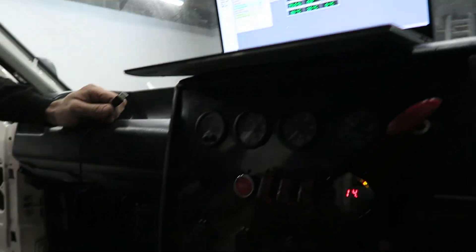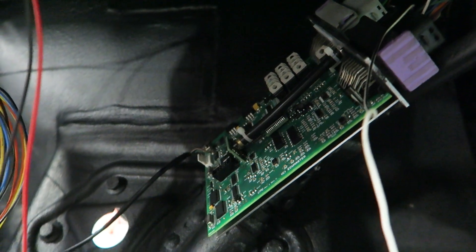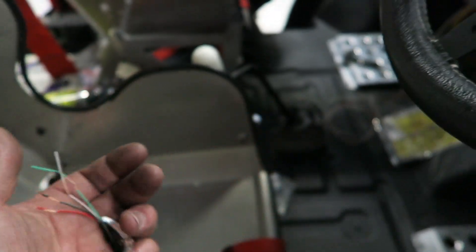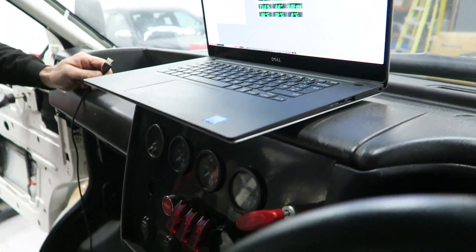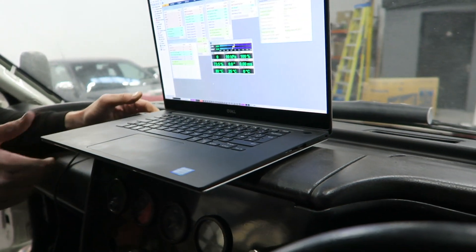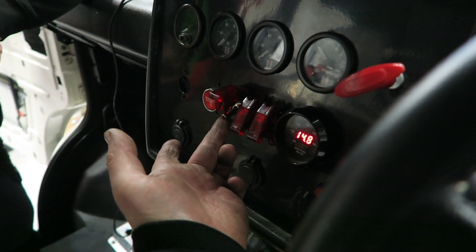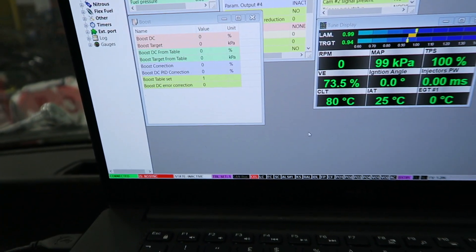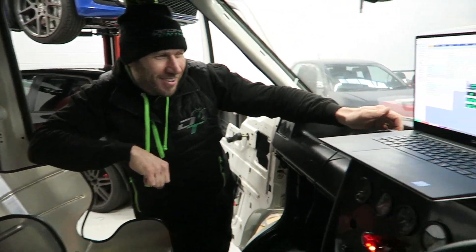We've just run into a short-term issue — the USB plug on the ECU got pretty knackered. We've had to take the covers off the socket. Nick's labelled all of the wires, we did continuity testing yesterday, labelled them all out, and he's wired it direct into the board. Nick's also wired in my switch. This is race van level — 500 brake horsepower ready.